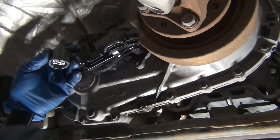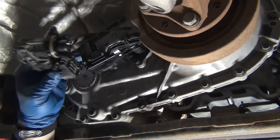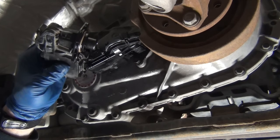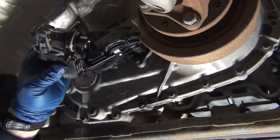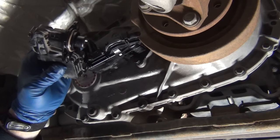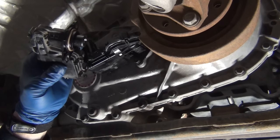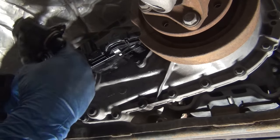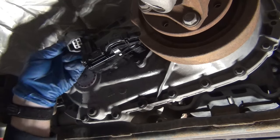So I pulled this off the new one. I'm going to plug the old one in — I just threw it together real quick. Key on. Is it in two or four? Two. Alright — four, two, four, two. Thing works like a champ now. Is the serv four-wheel drive light on or off? Off. See? Why I spend all that money. We'll put it on this new one and see if the new one goes bang. Everything was smooth on the transfer case side.